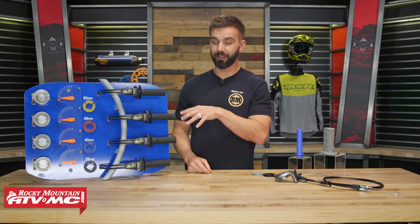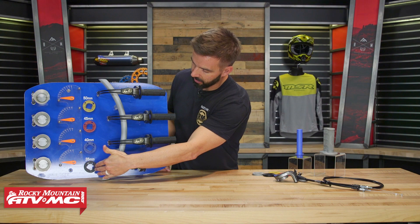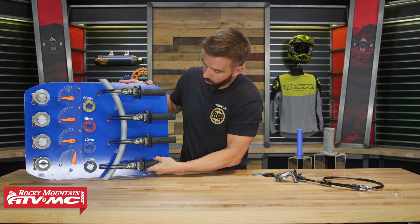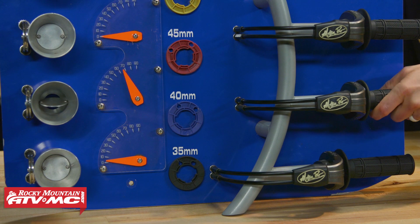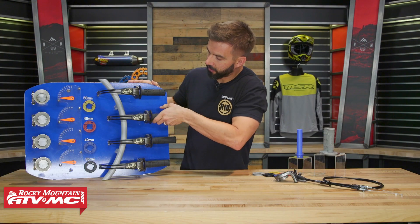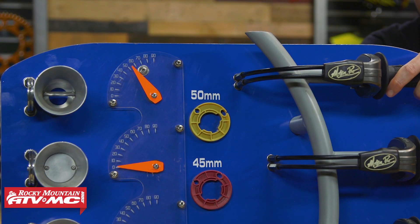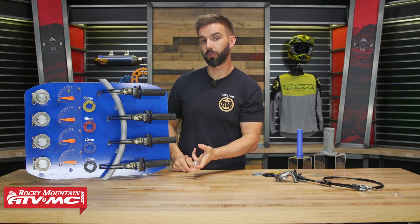Now let me show you an example — thanks to Motion Pro, I saw these guys in California and they had this display with them. I said you guys have got to send me that so I can show it in the video. On this board I've got all four cams — the 35 up to the 50. When I twist this throttle down here on the 35, you see that orange arrow gets past 90 before that valve is completely open. If I come up to the 40 and do the same thing, it doesn't even get to 90 before the valve is wide open. At the 45 it goes even less, and then up to the 50 — the most aggressive — you can see that needle is barely making it to 60 before that valve is wide open. That's the change in that throttle rate.